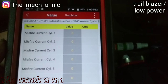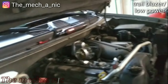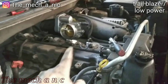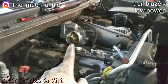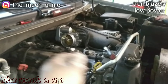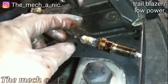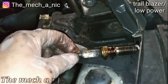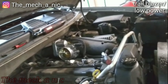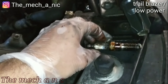Could this be a spark plug gap issue — fine at idle but misfiring like crazy once you get on it? I got the coil and plug out of cylinder number five. Last time I was in here was months ago — maybe even a year ago. I replaced one ignition coil — you can see how that one looks new compared to the others — and it also got a new throttle body. The owner can't remember the last time the plugs were changed. These plugs have been in here for a long time. There's some oil inside — the valve cover gasket is leaking a little bit — but it wasn't puddled up so it's not severe.